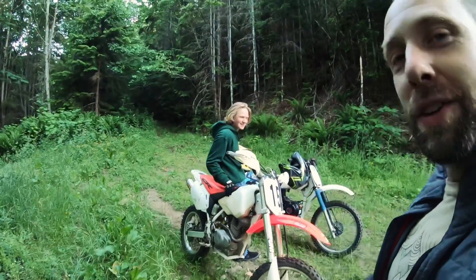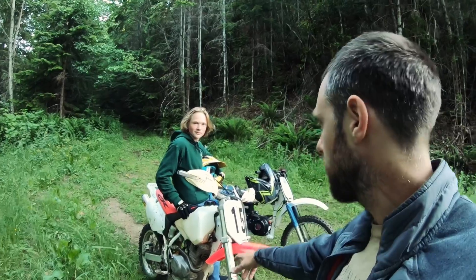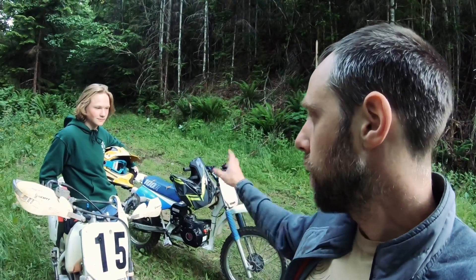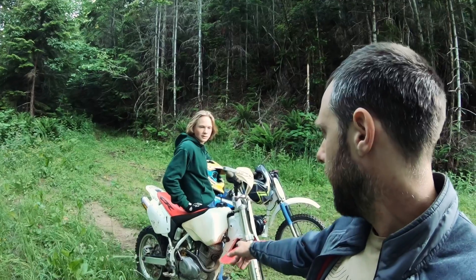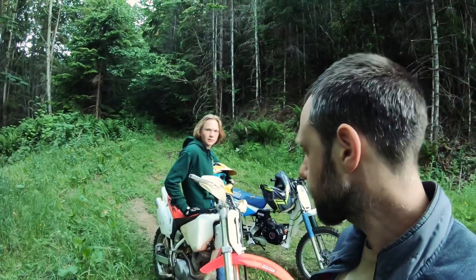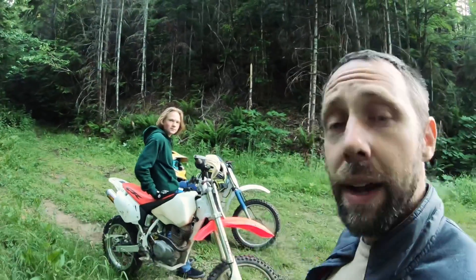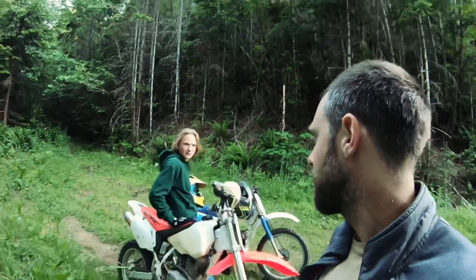This isn't any ordinary CR80 big wheel and it's not an ordinary XR100 either. We got a 120cc motor in here — it was actually the XR100 motor that came out of this bike originally. We tricked it out: put a 120cc BBR kit in here with a high compression piston, 120cc cylinder, and big cam. We have an FMF exhaust system and XR200 carb on it. He outgrew it when he was younger, and we found this CR80 big wheel with a locked-up crank and wanted to make a good trail bike. So we grafted that motor in — it's a high performance machine, so it'll be interesting to drag race it against the Predator which has 212cc displacement.